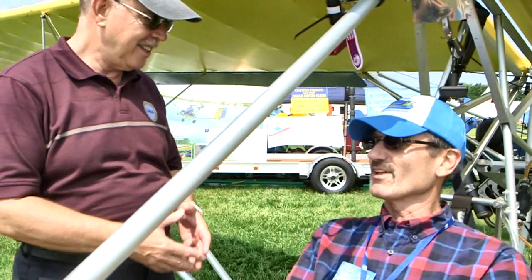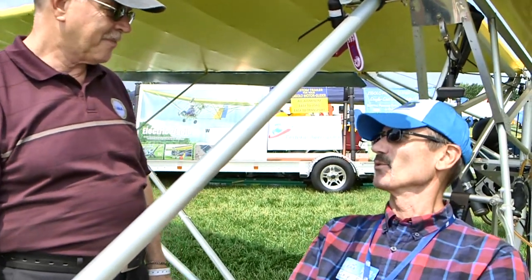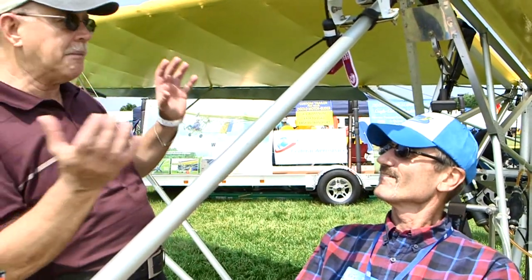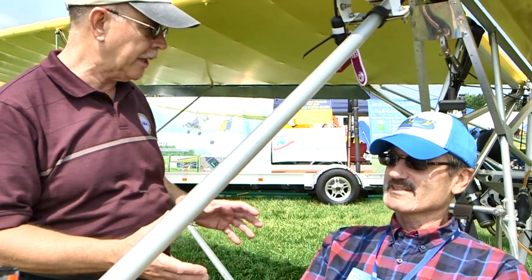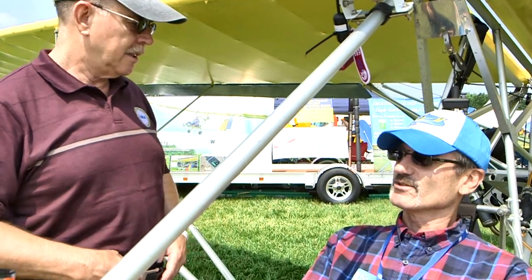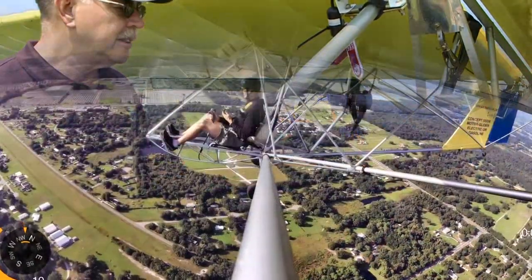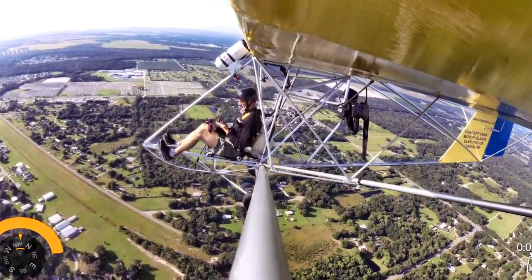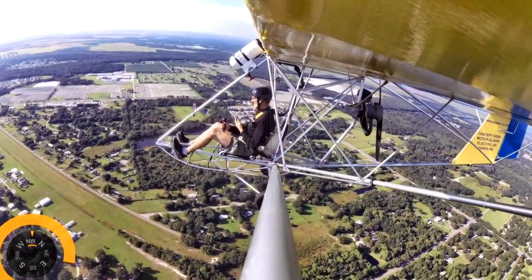What do we got here, Chip? Well, this is a motor glider that fits in the ultralight rules, but it's a bit of a misnomer. It's not really much of a glider because it's such an open-air, non-high-performance aircraft, like a composite. But it's a floater. It's pretty light — really light. What it lacks in aerodynamic cleanliness, it makes up for by being purely light. It's got a big wing, so the wing loading is light and the sink rate is low. You can go up on a mild thermal day, catch those thermals, soar around on it, and turn the engine off. So it is a motor glider in that aspect.